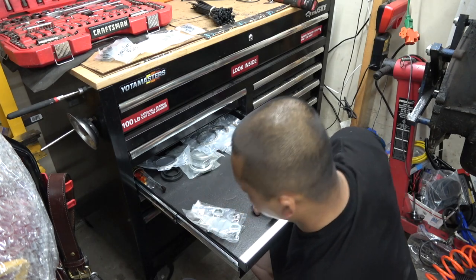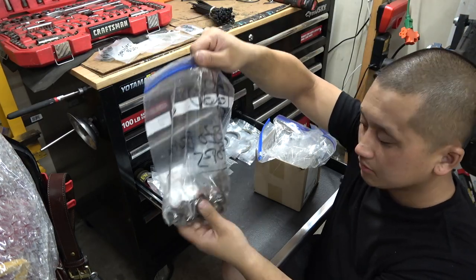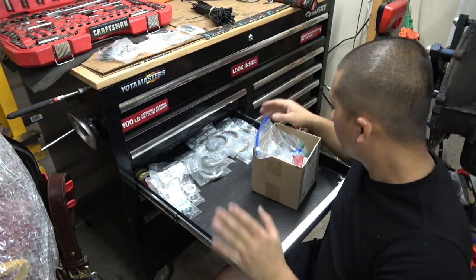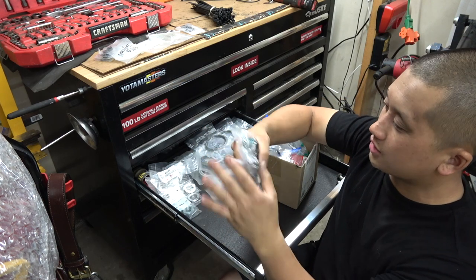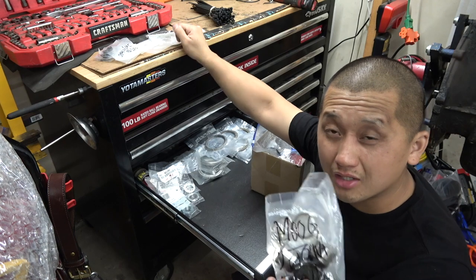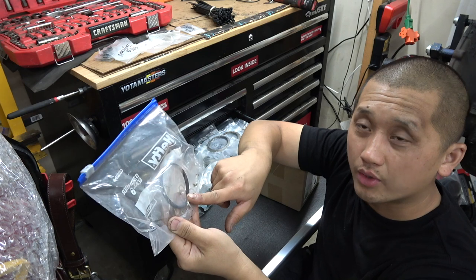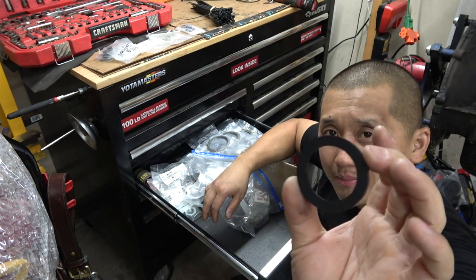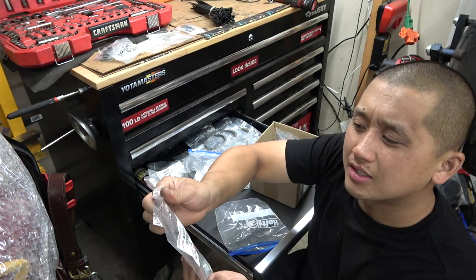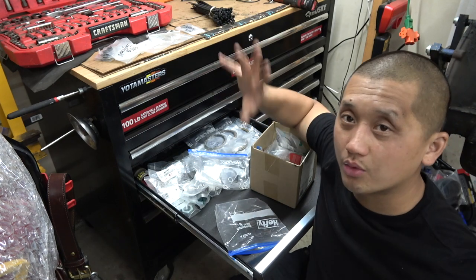This other box — let's check it out. These are bolts for the front hub to the rotor, vacuum-packed. I also have more driveline bolts — the ones I was telling you guys about. This is a brand new Moog U-joint for the front — make sure you label it, because the 80 series front and rear U-joints are different sizes. This is a thermostat gasket along with some crush washers for the fuel rails. There's a rubber O-ring I think for an oil cap. And exhaust nuts — remember, exhaust nuts are one-time use — part number 9008017187.